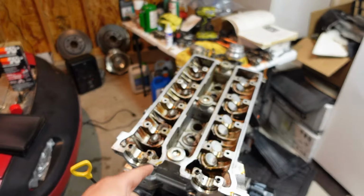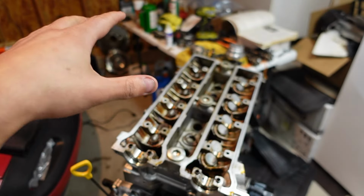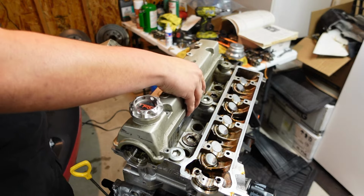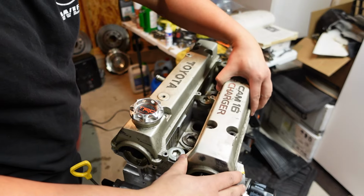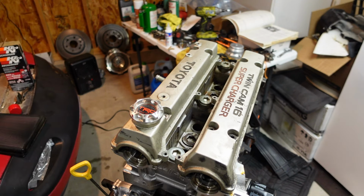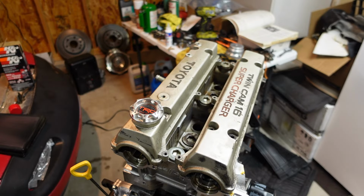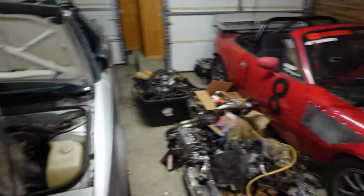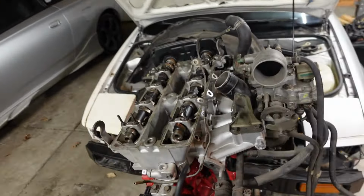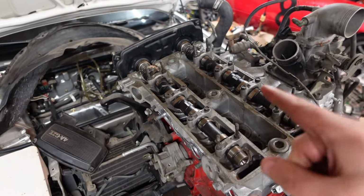All right, so now this is ready for the new cams. I'm just going to put the valve covers off of the supercharged engine on here, just so they can help prevent getting any dust in there. Of course, there's still some dust that can get in through there, but not too worried about that. But that'll bring me over to here to be able to get the HKS cams out and get those in